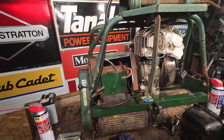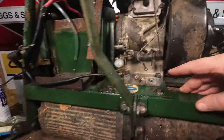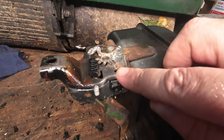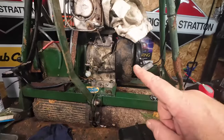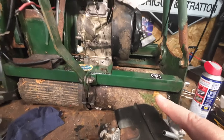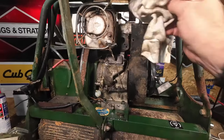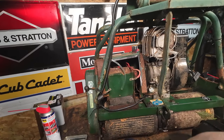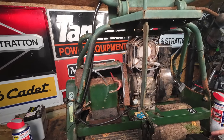So we are technically ready now to refit this back onto the machine. The only thing we've got to remember is there's a little tiny spring that goes here, and that's got to be fitted onto the back side of the tank — it's got to sit onto that little tiny arm just there. Once that's been fitted, we can then push the tank onto the engine, line up the air intake, crank breather pipe, and then hook up the governor arms loosely before we fit the carburetor to the engine. So let me reposition the camera so you guys can see a bit better.